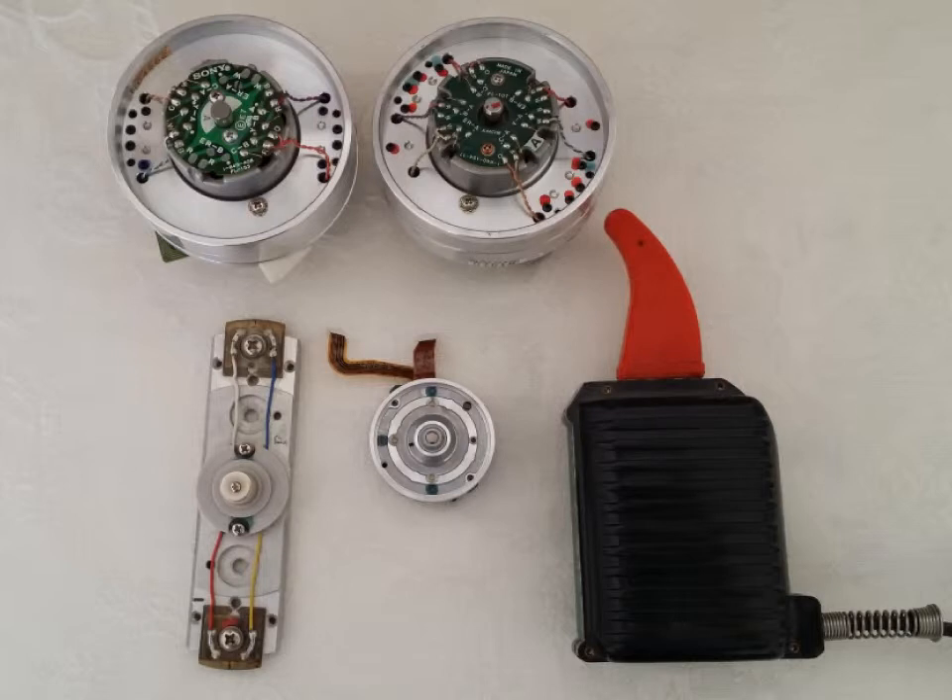That will actually get your video to play clean and won't be as grainy. When you're doing vintage tape transfers, it's very imperative that you do this if you want really clean, noise-free video. You want to clean your video heads between every tape transfer — every time you run a tape. Do not clean your video heads only every 10 or 20 tapes; that's a lot of build-up. Clean the heads after every single tape pass — both the gap and the outer edge.